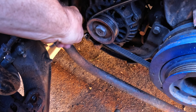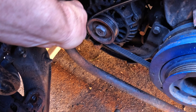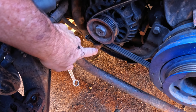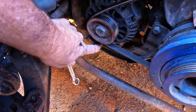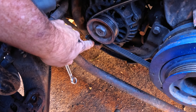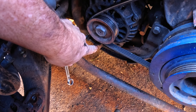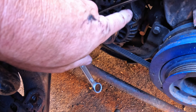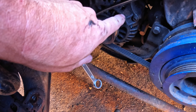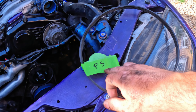There's a 13mm bolt down here. Turning this many times slowly is going to pull that over there, which will pivot the alternator back and tension the belt up. Once I've done that I need to clamp up the back of that - which is really awkward to get to - and then there's another bolt up top which is the pivot bolt. That all needs to be tightened up. Belt is on.